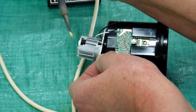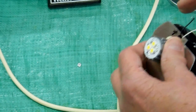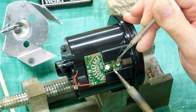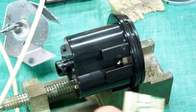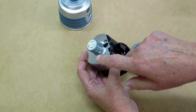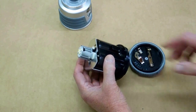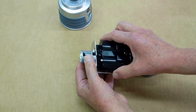I probably shouldn't have pried this apart first. That wire goes under there and feeds down through the center. Now I'm going to unsolder this tab — okay, so now that's unsoldered. Now the circuit board will come out. This aluminum piece is a heat sink for the three LEDs and it's epoxied to this aluminum plate which is an additional heat sink, pushed down on this piece of plastic. Most of this stuff is not intended to be taken apart, so you have to go about it gently. I took a screwdriver and gently started prying this apart until it cooperated and separated.